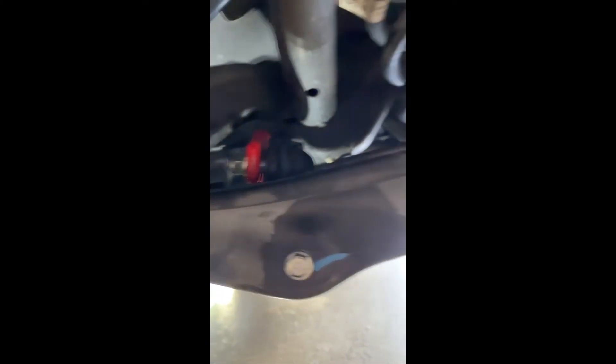All the mounting hardware is slightly tightened — not completely tightened all the way down. With the car on these supporting blocks, it's applying a loaded condition to the suspension. You don't want to tighten everything under an unloaded suspension because parts will end up sitting in the wrong position when everything compresses. When it's compressed you're tightening everything where it's supposed to be under normal conditions. That's why I have these here — now I'm going to go through and tighten up all the suspension bolts.